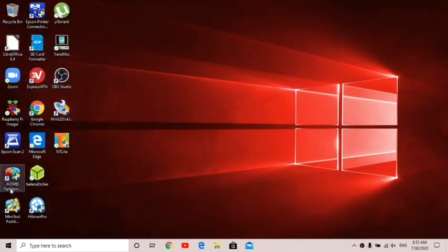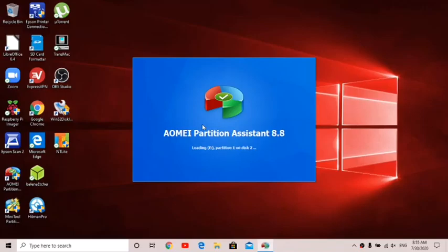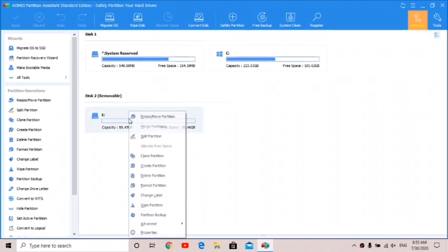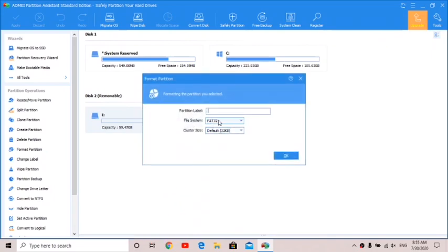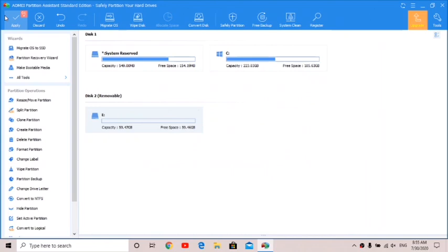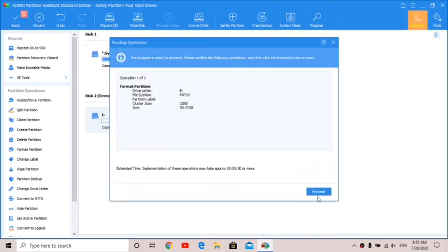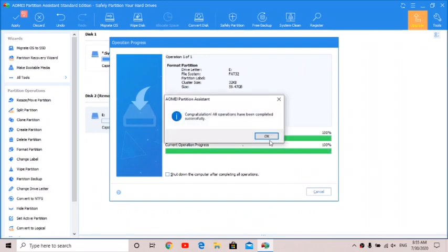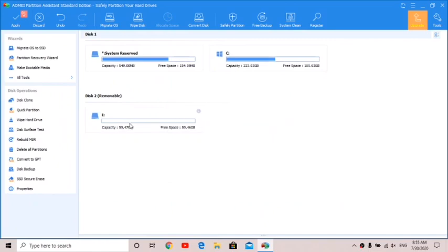I'm going to be using AOMEI Partition Assistant, and the link to this will be in the description so you can download it if you need it. But if yours is like a 16 or 8GB SD card, you can just format it on Windows. You don't need a tool like this. So just go Format Partition, FAT32, OK, Apply, Proceed, Yes. Okay, as you see, it's done now.